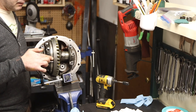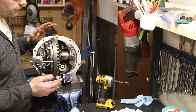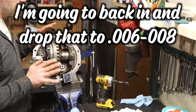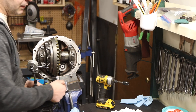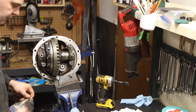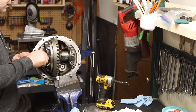It may not be possible to get a perfectly centered, perfectly deep, perfectly round pattern, so my instinct tells me I'm where I need to be. I checked run-out by putting the depth gauge against the back face — I'm at about 2.5 thousandths, which is within spec. My backlash is at 10 to 11 thousandths; the spec is between 6 and 12, so I'm okay. Now I need to put the locks on and make sure I put the O-ring on the pinion housing.